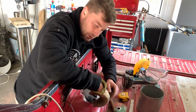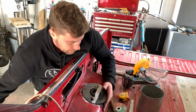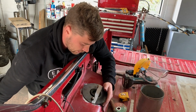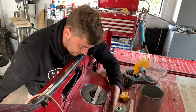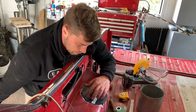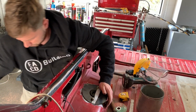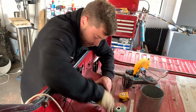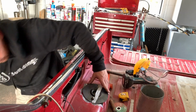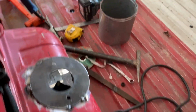The way we're going to position it is we're going to use the strut. Now what happens is I'll be moulding the guard a little bit, and this will be reinforced later. So you can see how that's pulled the guard down there, flush with that side, which is good. It means that there's a bit of tension on this piece of metal, and what it'll do is stop it from flexing later because it's already flexed. So it's tacked in place. Pretty happy with that. My crude tacks.